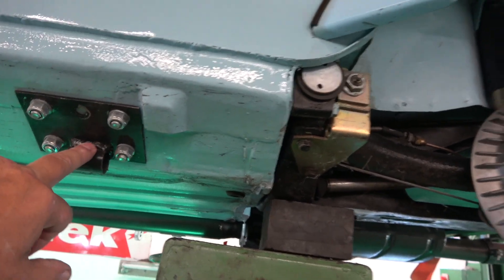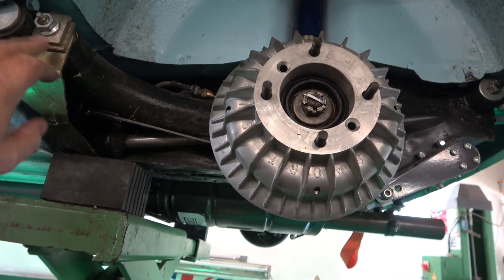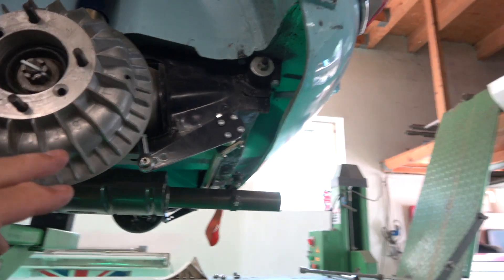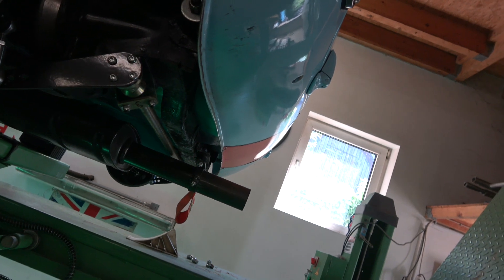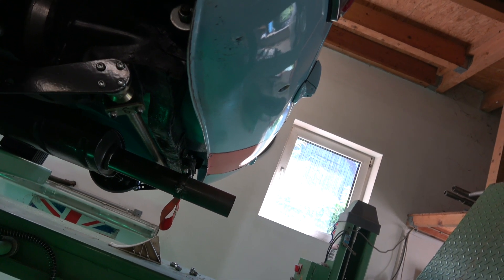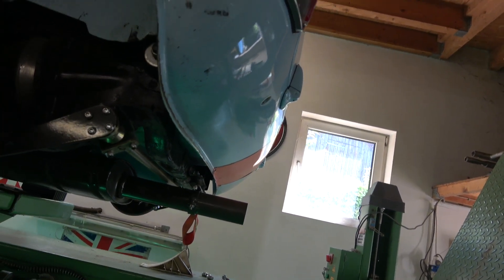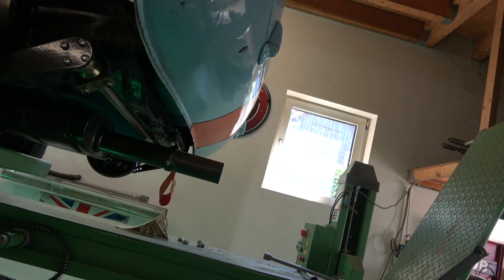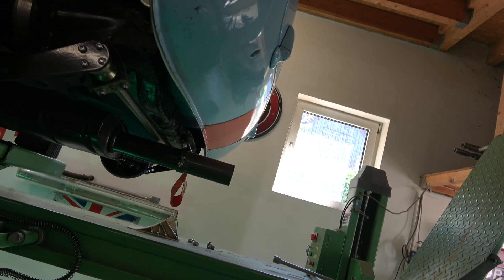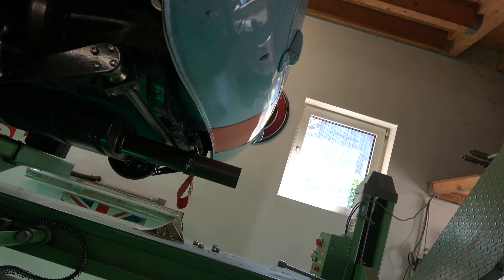This is the upright for the roll cage on the back. Inside you've got adjustable radius arms - adjustability on the radius arms. This has got high-low suspension on it. This is another piece of kit you might not be aware of - this is basically an anti-roll bar for the rear but it's a 5/8 bar so this is not for road use, only for track use. It's too stiff for road use and basically what this will do is as we go around the corner it will stop the droop in the radius arm and losing wheel contact with the track, so you can slide the Mini into the corner with only half the traction on whichever wheel you're dipping into, whether it be left or right.